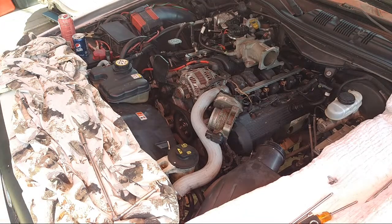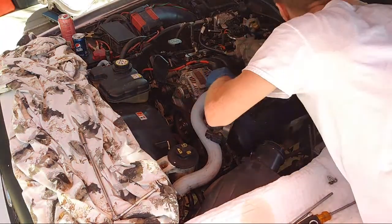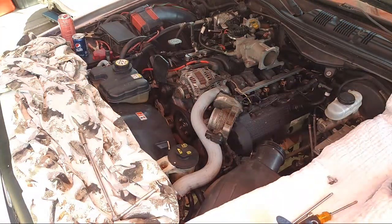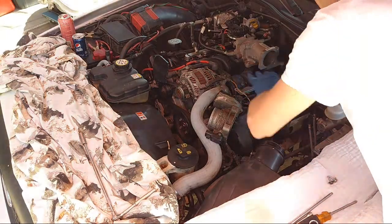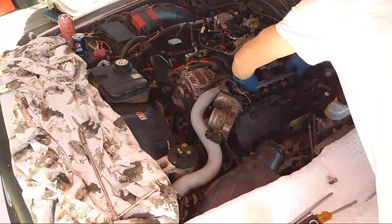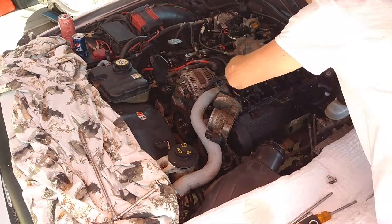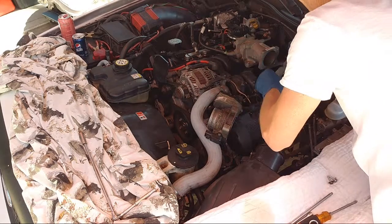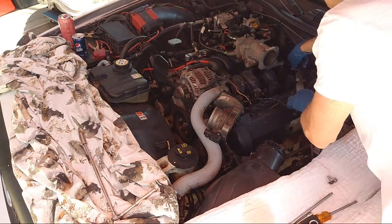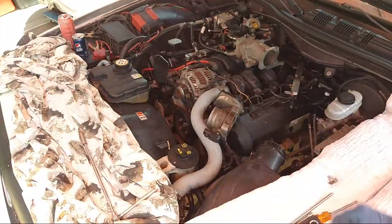Okay, so those are off. Pop this fuel rail up. This stuff is already cleaned up, but we'll wipe off the little rubber O-rings and whatnot from this fuel rail when we pull it up, before we pop it back in there. Let's go ahead and pop this up. Just be careful popping it up. Boom, there we go. Just going to keep it loose. Just put it to the side. We're taking these back two off, so I'm going to put this to the side like that. I'm going to get a bungee cord to secure that right there.